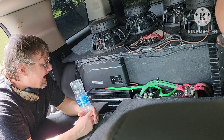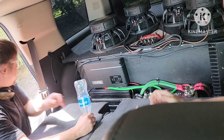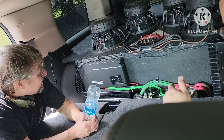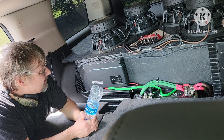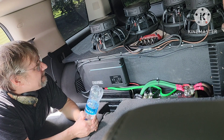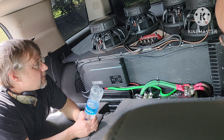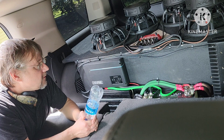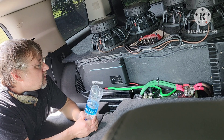To get those little flows up to a decent amount of power, you really have to have a lot of batteries. This supercapacitor replaces a lot of them. In the car audio world, you could go from running five or six batteries to running maybe two batteries and a supercap and accomplish the same goal. You don't need that huge amount of capacity — you need the ability to put power into the amplifier quickly.